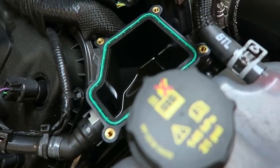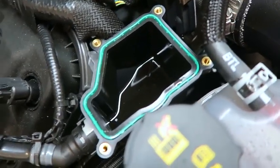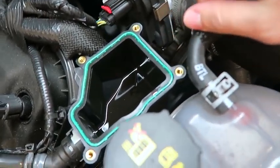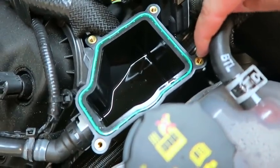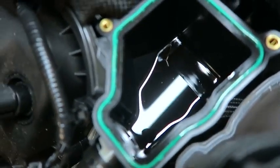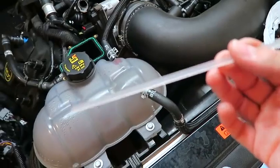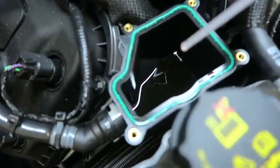The oil separator cap is off. Note to anyone that has these oil separators or is planning on getting them — this radiator hose is a bit annoying because it gets in the way to remove the fourth screw, but you just have to pull on it a bit. It does seem like it did catch some oil, so it seems like it's doing its job. I have this little plastic stick here and I'm just going to use it to measure how much oil there is in there.